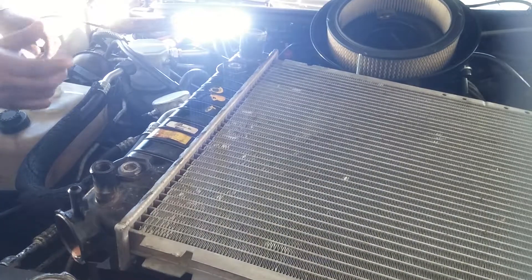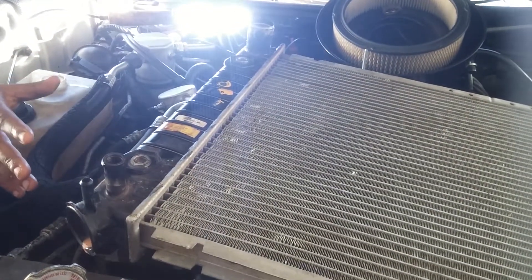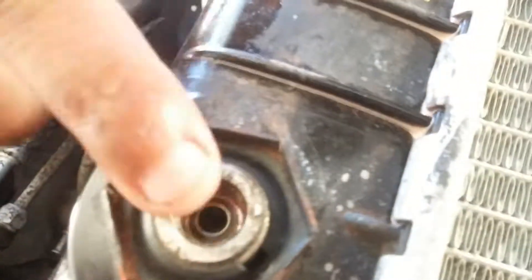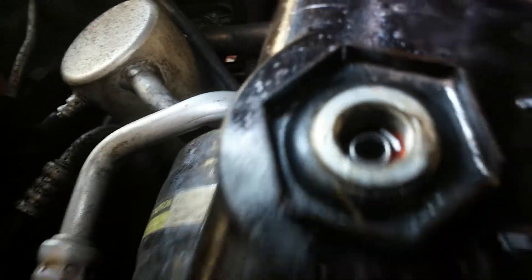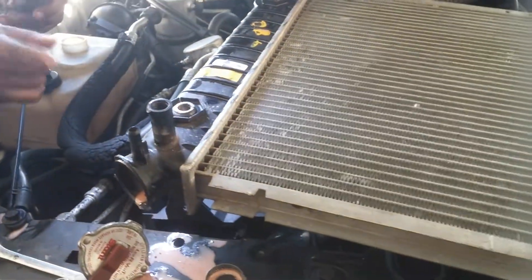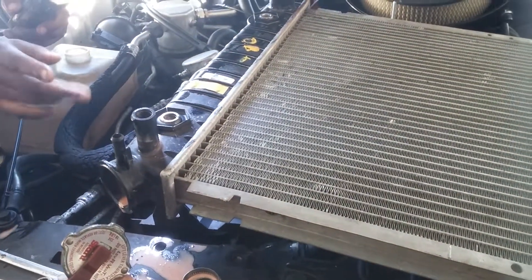So I have a milky pinkish color coming out of my radiator and it's also in my heater coil. Basically what that's telling me, being that my block is good — these transmission lines here go into these radiator ports. You can see that the transmission fluid at the bottom looks like transmission fluid, but up here at the top you don't really see a trace of it, which lets me know that water and transmission fluid is leaking from that top port.